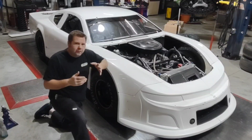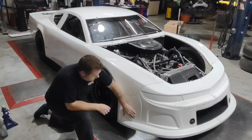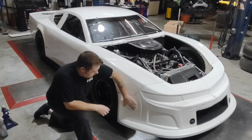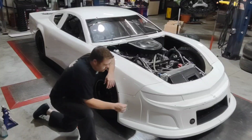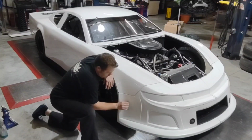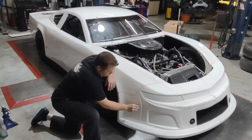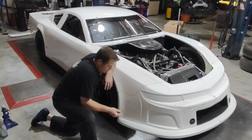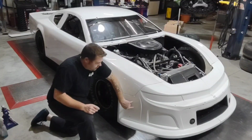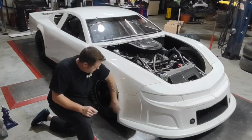A couple different ways that I go about getting those out: in an area that is flat, that has no real contour to it, and you've got a lot of those little pits, you can use your razor blade and just scrape it. Don't cut into it because you'll dig in and leave a mark there. But if you just scrape it kind of aggressively, as long as the corners aren't leaving gouge marks, you can actually knock those down a little bit and clean that piece up.